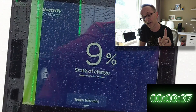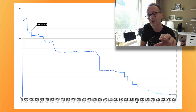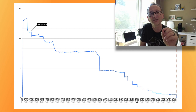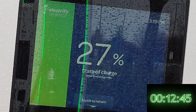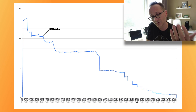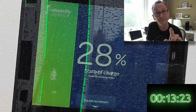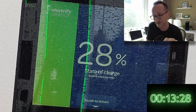After 8.5%, it starts ramping down to 110 kilowatts, and that lasts until six minutes in when we're at 14% charge. So at six minutes in, you already have 14% from zero. It then goes down a little further from 110 to about 105 kilowatts, and that lasts another seven minutes until 13 minutes and 30 seconds. At that point, you're at 29% state of charge.